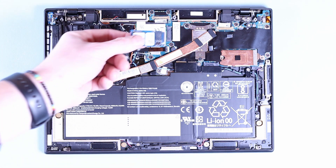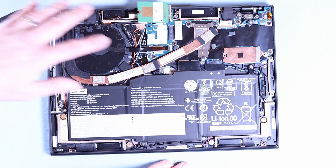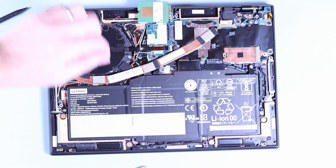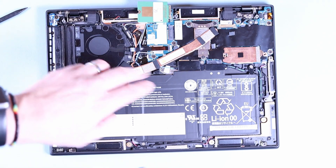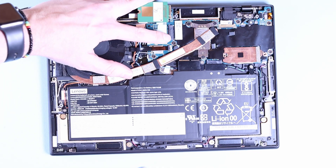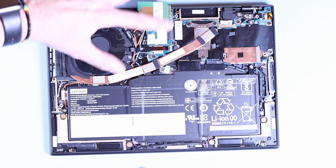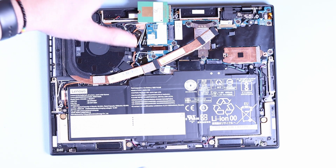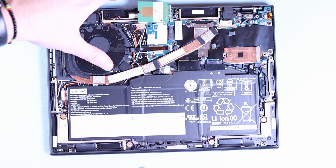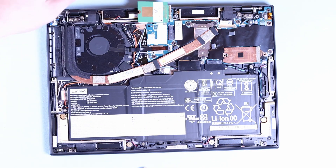What I'm going to try to do is see if I can get this to boot in the WAN slot. Removing the WAN card, we can see that the NVMe Western Digital SSD — the 42 millimeter — doesn't fit this connector type. It's probably going to be a Type B connector, so I'll try and find out if we can find a matching SSD to upgrade that with later on. I was hoping we might just take that SSD out and try it in the slot, but you can't, which is a real shame.